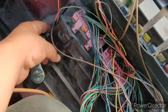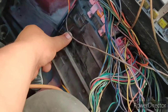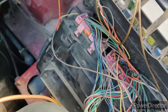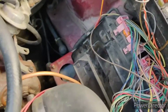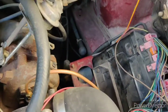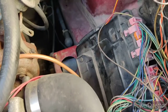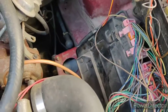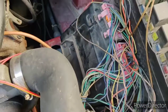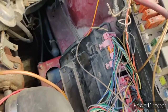It's out of a late, mid-90s GM W-body. It's got the EEPROM in it, it's weather tight — could be outside, but I put it inside. Running the code 8F right now, which is from a 90s turbo Grand Prix. I'm probably gonna swap it out for the code 59 3-bar, which is what the Syclone and Typhoon guys use — that has a whole bunch of tunable parameters.